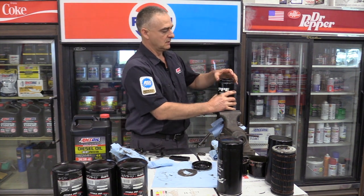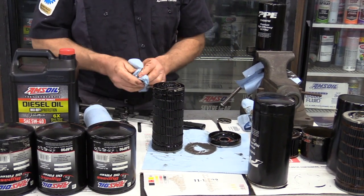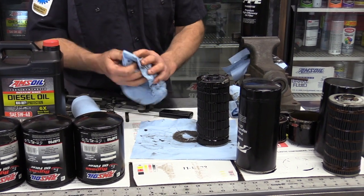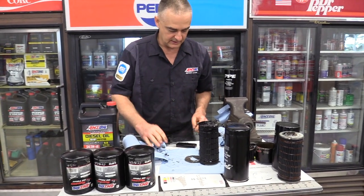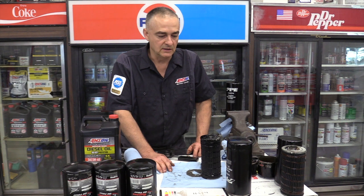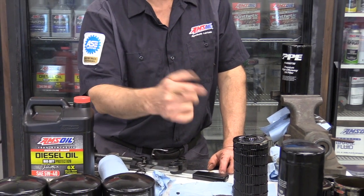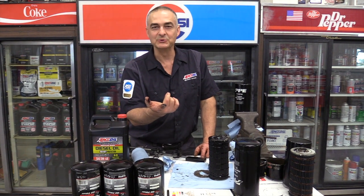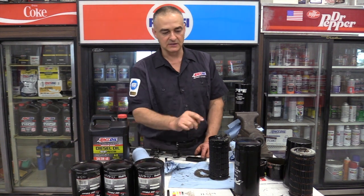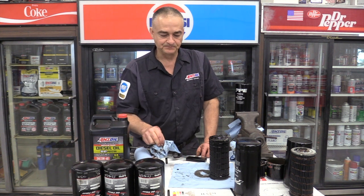As you look at this oil on the filter head, it looks black. I had a guy send me a video from YouTube of a fellow who put an AMSOIL bypass filter system on his truck — a diesel pickup — and he's saying you shouldn't bother putting on the bypass filter system from AMSOIL because it doesn't clean the oil. He had no oil analysis to see what the level of soot was at; he was just going by the color of the oil. Yeah, it's black at 18,000 miles — but I can't tell by looking at this how much soot is in it. The oil analysis can do that.